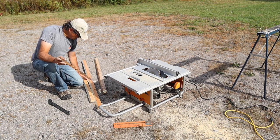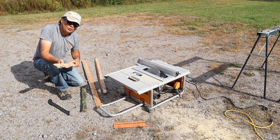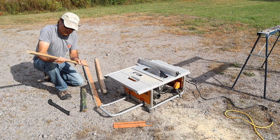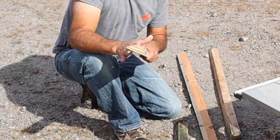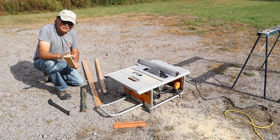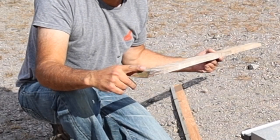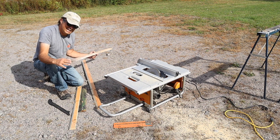For the side piece I just have to cut it to the appropriate length with the bevel. It doesn't have to be perfect because it's not furniture — it's going to be behind the endslide and any imperfections will be hidden. You just want a nice quality piece of plywood with no holes in it so you can secure your window to it. I'm going to stick to the initial factory installation method given that it lasted 45 years. For the longer bottom piece there are also bevels on the ends, so I'll use my chop saw to do 45-degree cuts on the ends.